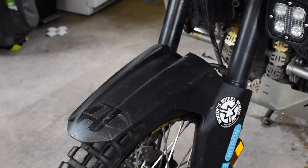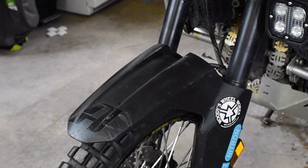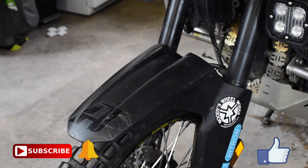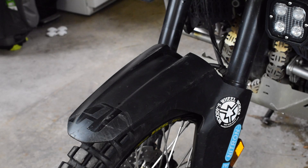So I'm installing this kit for a couple of reasons. Currently, I have the Fender Riser Kit on there, and I've got plenty of room in between the tire and the fender — that's not really an issue. The main reason I'm installing this is because there are some markings on the top of the fender. What that's from is when my suspension compresses during heavy off-road riding, it's actually compressing so much that it's hitting the upper crash bar where it ties in the middle. It hasn't done any damage, but I don't want it to. So I'm putting the High Fender Kit on for that main reason — and lastly, it just looks really good.